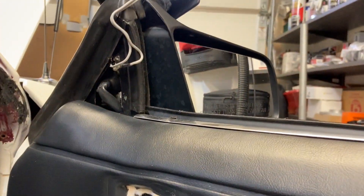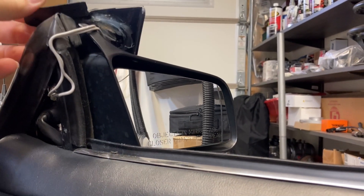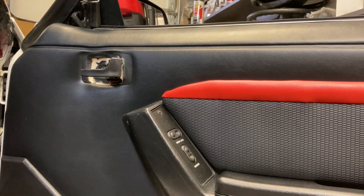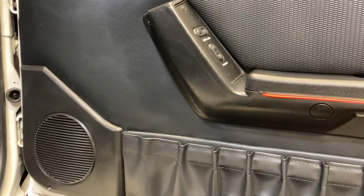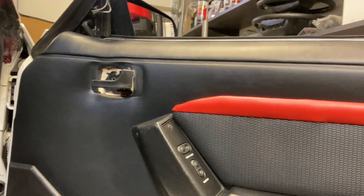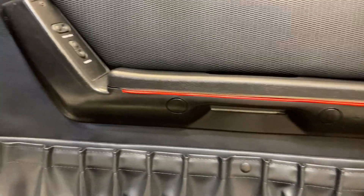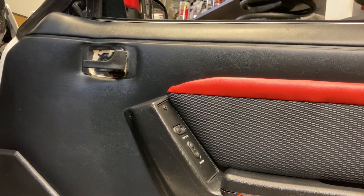Got my screws out and my trim plate. Most of you, your trim plate for the mirror will just come right off. I have a speaker inside it so I just lay it up out of the way. As you're taking your screws out, pay attention to whether they look like the original automotive screws — they should be black with a built-in slip washer. If they look like a machine screw or drywall screw, remember what location those are in, because if you buy a kit of screws, they're likely not going to work if somebody's made the holes bigger or stripped them out.